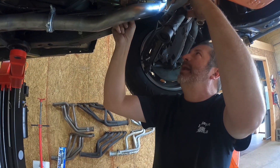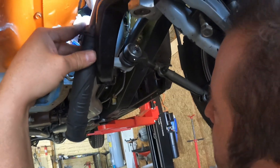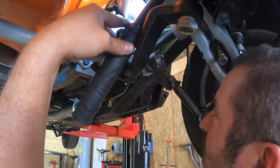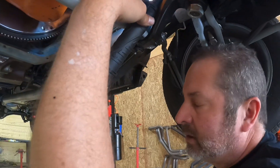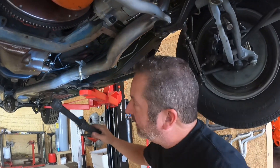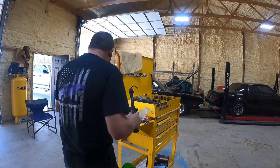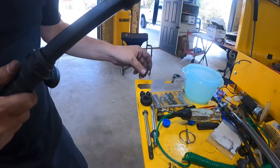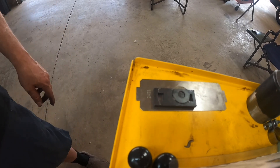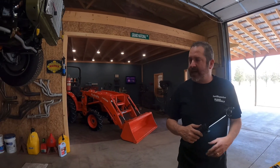I made a little tweak — I don't know what else to do here. I've tried and looked and this has been a six-month thing, and it looks like we've got it right. It shifts smooth, there's no binding or hanging. Now the shifter is a different deal. I adjusted the shifter properly with the pin, but while I was adjusting it I had these little shims come out and they just fell out. So I think this shifter may have seen better days. I'm going to let it down and show you guys how this thing works.